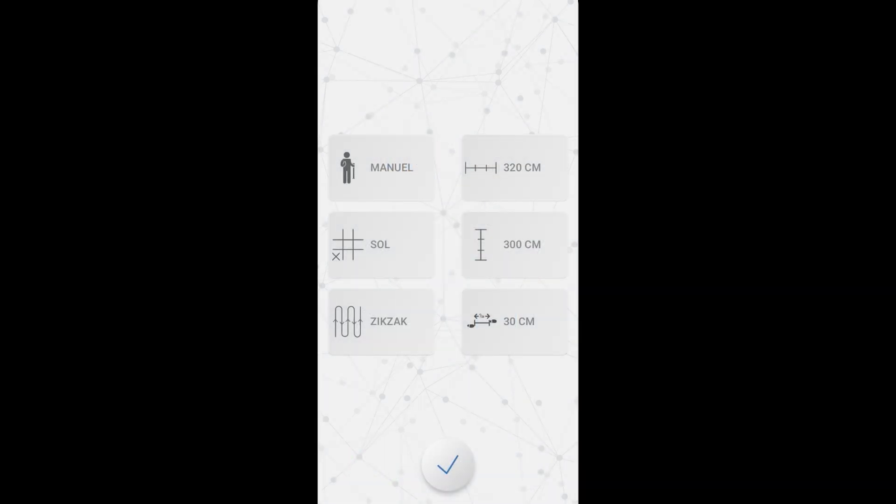We are currently viewing the page where we set the shot range for scanning. Adjust the settings for the designated area using the 6 available icons. Click the manual icon on the top left to access the sampling options — set whether samples will be taken manually or automatically at a certain time interval. When pressing manual once, it switches to automatic sampling at a specific time interval.